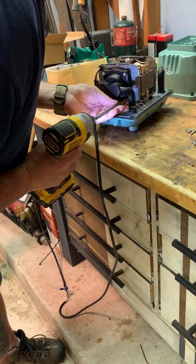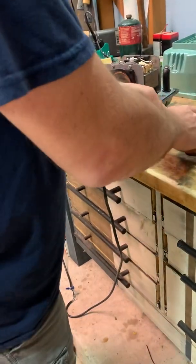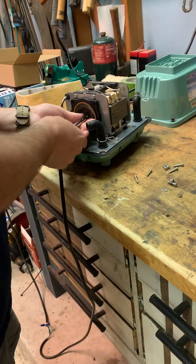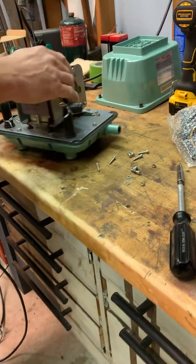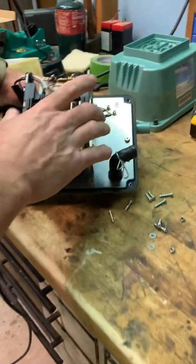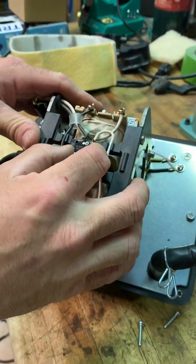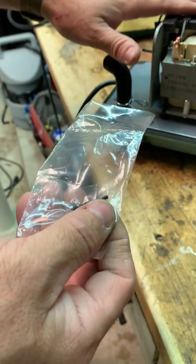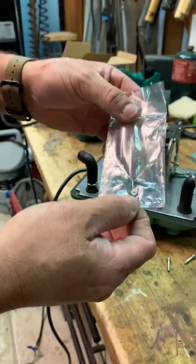You can find a huge amount of videos on YouTube and on the internet — this is just to try to save you a little bit of money. The only thing you're saving are the screws, but most kits come with new screws anyway. This is the reciprocating part that slides back and forth. One thing I want you to pay attention to: up here is a switch. Once this fails, this switch basically turns the pump off, so you want to reset it. There's another type that takes a fusible link — it breaks and shuts the pump off so it doesn't burn the motor out. Either way, you need to reset this switch to get your pump working again.